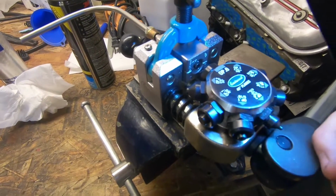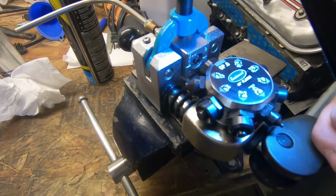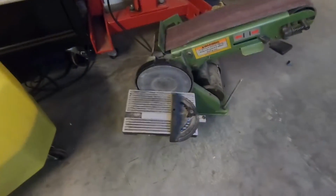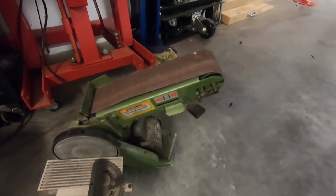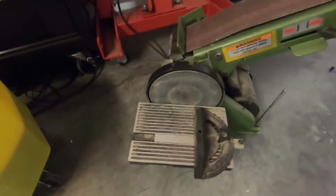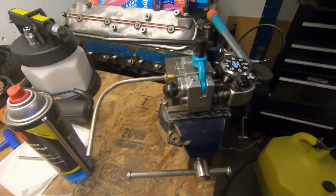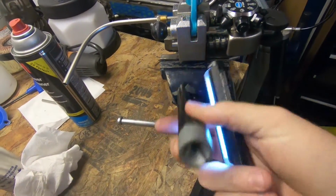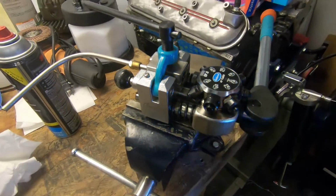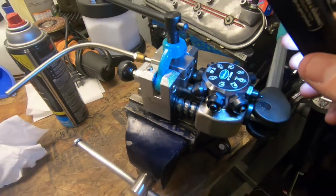Basically what I did, I used a real fine hacksaw and cut that tubing to length. I actually cut it an 1/8 inch proud to take into account the flare. What I do then is take this, my trusty Harbor Freight belt sander, which the actual belt sander portion of it's junk. That belt wanders no matter what you do. But I true up the end as best I can here, and then I use this inner and outer chamfering tool that I bought from Eastwood with this flaring tool here, and just clean it up. So it ends up putting a real nice finish on the end there.